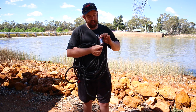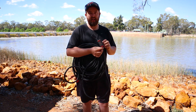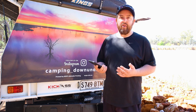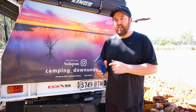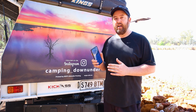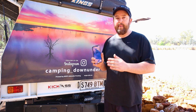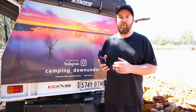I've got this Kick-Ass amp meter, so I can tell exactly how many amps are going straight from the solar panel to my car — that's not a bad idea. Not only do I have the Kick-Ass amp meter that plugs through the solar panel, I've also got another way of monitoring my batteries. I've got the Victron battery monitor mounted in my car, with an app through my phone, so I can always monitor how much voltage is going in or out of my battery. I can monitor each device, turn everything off and just have that one device on, and see how many amps that one device is drawing at any time — so I can keep track of my batteries anywhere.